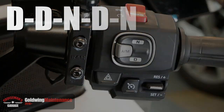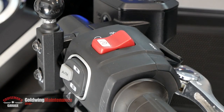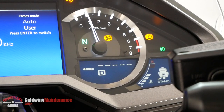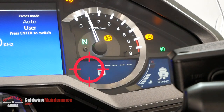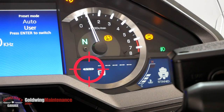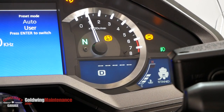After you've entered that code, start the motorcycle and let it idle. Don't touch the throttle from this point forward. If you turn your attention to the dash, you'll see an emblem flashing next to the D emblem — this should be flashing about every two seconds. For a few moments, you may hear some noises in the transmission; that's it shifting through the various gears and reprogramming itself, and it's perfectly normal. Just let this initialization procedure run as long as it takes. I'm doing this one in real time so you can see how long it took on my transmission.